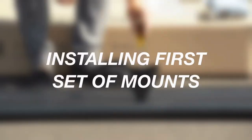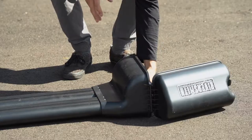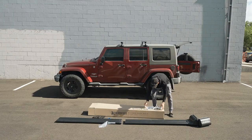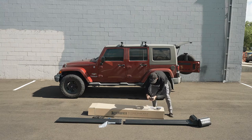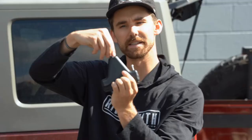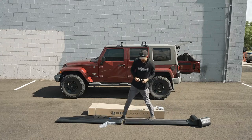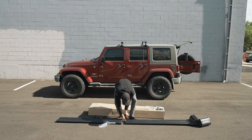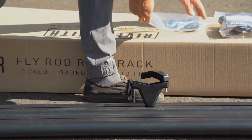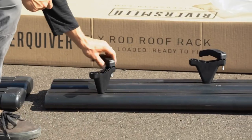Now we've got our first half marked here and we're ready to start putting the mounting brackets on. All the mounting brackets are going to be living inside the real box with the keys, manual, and the mounting brackets are going to have the bolts already in them ready to go — you just have to lightly unscrew them. On top of the mounting bracket we have a T-stud, and this is what's going to slide through the T-channel that goes all the way across the extrusions on the River Quiver. Just sliding them down to the mark I made earlier, I'll loosely set that one there for now, then take my second bracket and do the same thing.